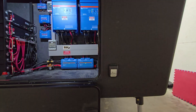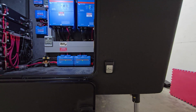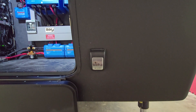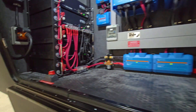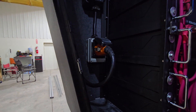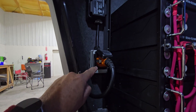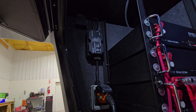All of our implementations have a forward shore power plug right here. We use smart plugs exclusively — there's very superior plug technology. You have your rear and your front, and we always put bypasses in so you can bypass the entire system. The way we do that is with the smart plugs. This plug is coming from the inverter, plugs in here, goes up to the progressive, and then out to the load centers on the RV.